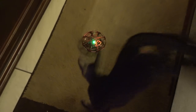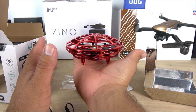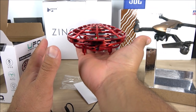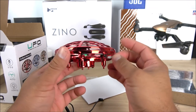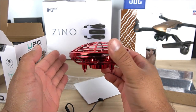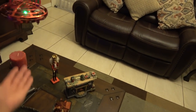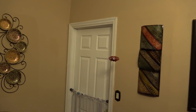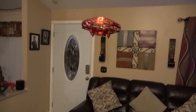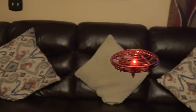I've been using it for about five days and it has held up quite well. On the bottom there are sensors — so if you place it on the palm of your hand and let it go or throw it, it'll activate the motors and start flying. There are also sensors on the side responsible for crash avoidance and hand control. If it's flying and you place your hand near a side sensor, it'll move the opposite way. Keep in mind it only has two side sensors, so sometimes it could hit an object on the side without a sensor, but it will try to get back in place or just turn off and fall.